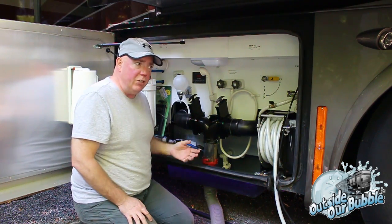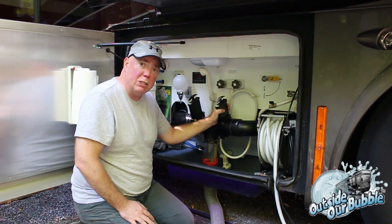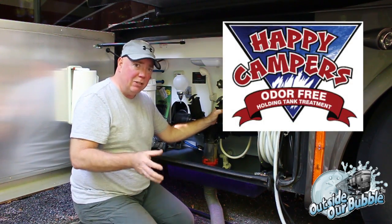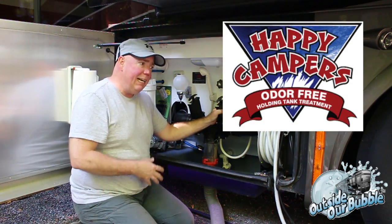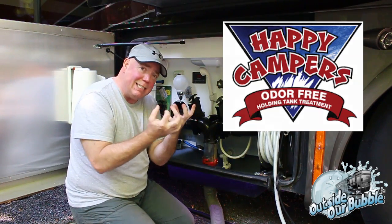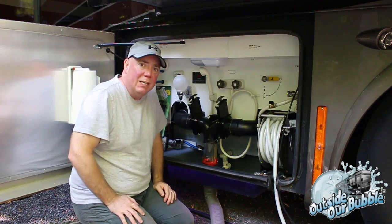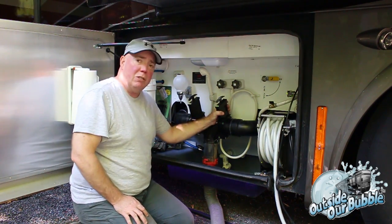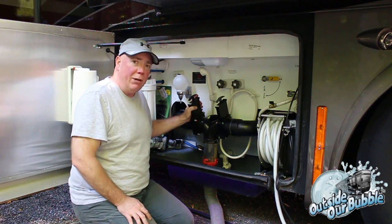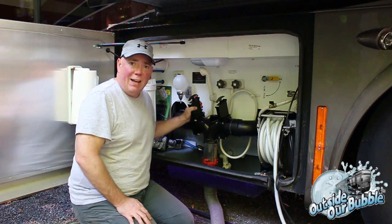And so what we do when we get ready to travel, we let the gray tank get to about 50% full, and then we'll put in some Happy Camper. That's a chemical that we like. Put that in, let it sit, slush around as we're driving, and that breaks down all the greases and everything. And then as soon as we get somewhere, we open it up and flush it all out. So there's your pros and cons of opening or shutting the gray tank. But the black tank is very important. Leave it shut until you want to flush it. And that's about that.